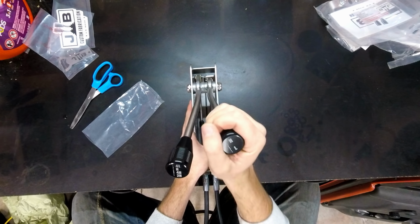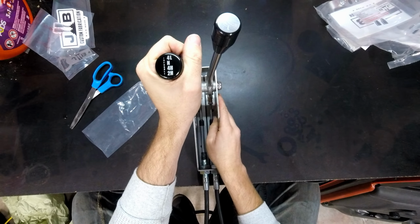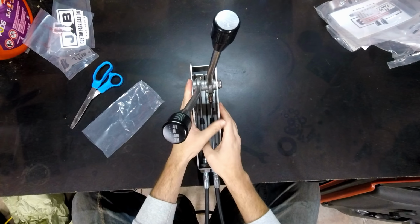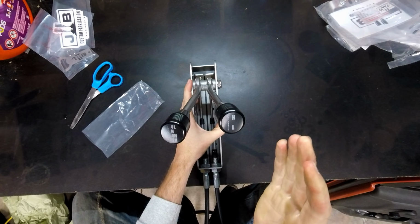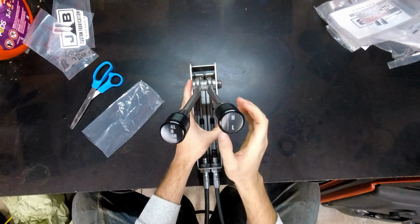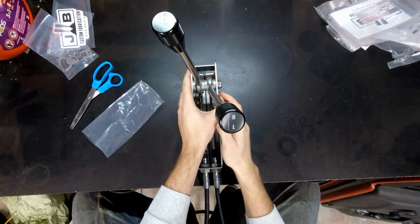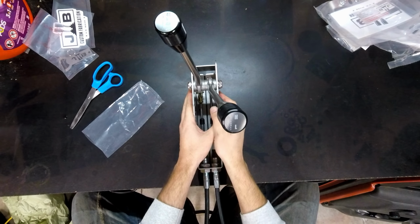Now, where it gets interesting is I can be in high gear, I can be in 4 high, neutral, and I can be in 4 low, or I can be in, oh, I missed one. I actually can be in 4 high, but move the planetary doubler kit into low. So now I'm actually in a 2.72 to 1 gear ratio on both the front and rear axle. And if I go to neutral and then 4 low on the rear transfer case, and I have this one in low gear as well, now I'm at that really neat 7.39 to 1 crawl ratio.